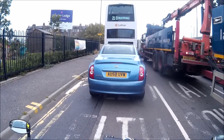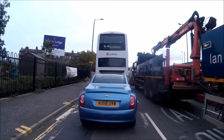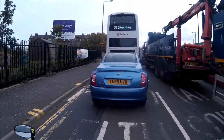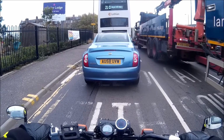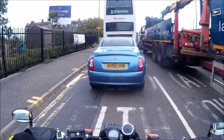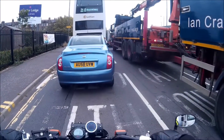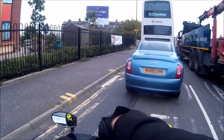Interesting stuff though. We're turning at the corner here, and this, if the traffic's okay, will allow us to get up a little bit more speed. It's a 40-mile-an-hour road. Of course, if it's full of traffic, it's not much use. But we'll see if we get any extra speed. But bear in mind, we've only put the 20% up to a certain level of the throttle, so there's definitely more to give here, I think. And it's also worth remembering the injector won't put in more than it's able to, so we can up the limits if we want. It's not going to go crazy.